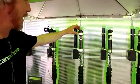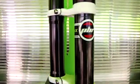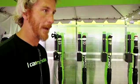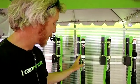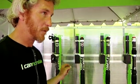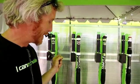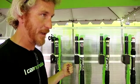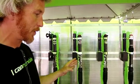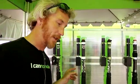Moving up — PBR. Super easy lockout, rebound adjustable. You'll notice in this one there's no overlap in the lower. Like our stems and the upper clamps, as well as the backbone on the RZs, we're 3D forging that whole piece. Less parts means less weight, but it really gives engineers the ability to control every radius, every tolerance, and forge that right in. Forging aligns the grain structure better, making a lighter, stiffer, and more fatigue-resistant part. 3D forging — amazing.